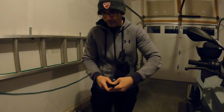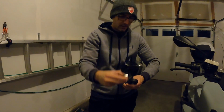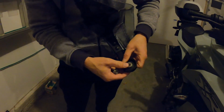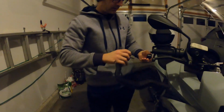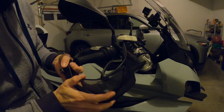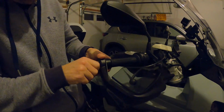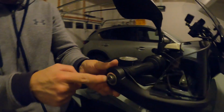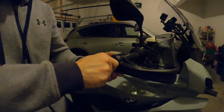Now, this is the only thing you got to be mindful of: when you're putting this bolt in, particularly, I don't know what this thing's called, but when you're putting it in here, you want to make sure that it seats in just like that all the way, or else when you go to reinstall your spacer, it's not going to fit. All right, so once you've done that, you're just going to kind of put the spacer back on. You can hold that up with your other fingers. There you go. And just get that started with your hand. All right, so you want to screw that all the way in there. Make sure that it's seated correctly. So if you take a look right there, you'll see this, whatever that piece is, that bracket is seated inside of this assembly. And that's that piece I was showing you that's important to get lined up.